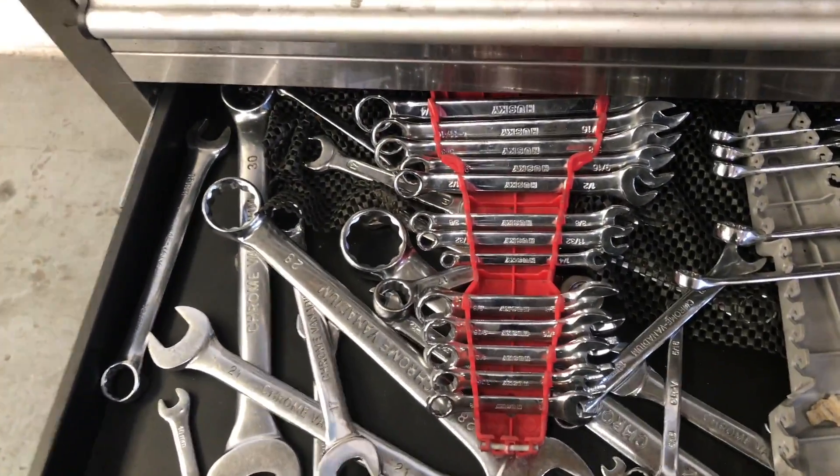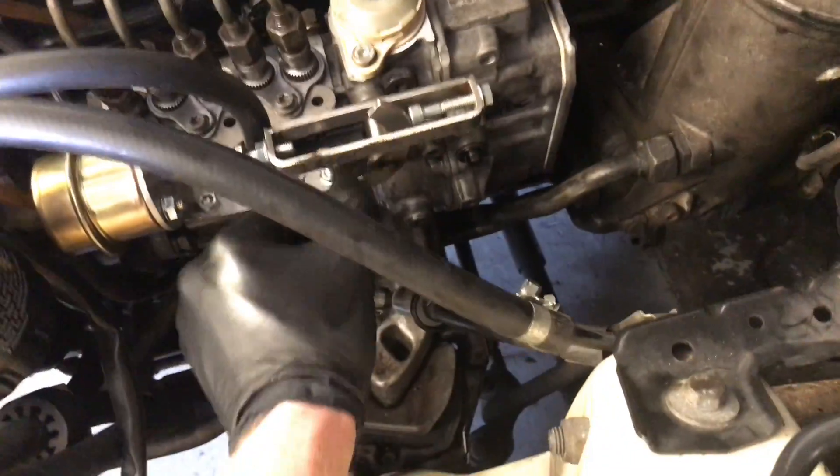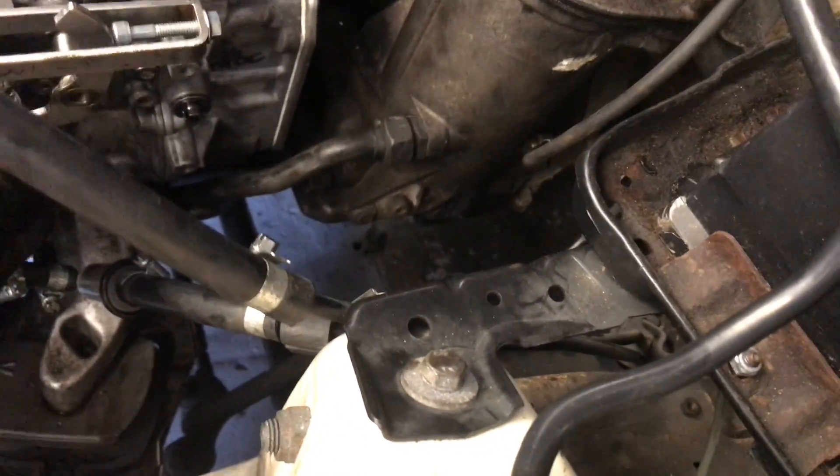Crown says yes! I'll get the 10mm spanner, just a minute. How am I supposed to find a spanner in this? That's ridiculous. Take a spare nut, and with the spare nut you can lock the position of your original nut, so you can put it right back to where it was safe so the customer doesn't blow the engine up. This pump's a 120 max. Fuel turned all the way up — it's run number 4 or 5 — with the new pump. Let's do this!